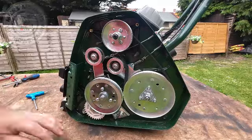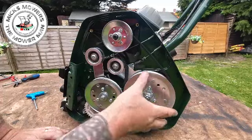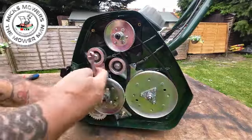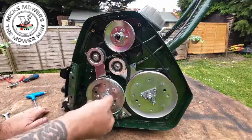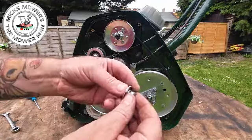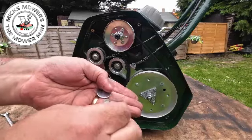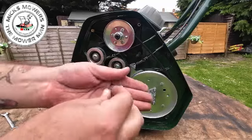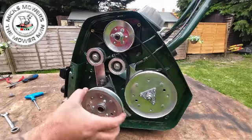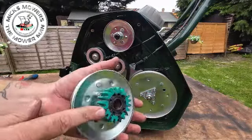We're now down to the meat and veg inside the inspection panel. This one here is your cylinder pulley, this one here is your drive pulley. On your cylinder pulley there'll be a 10mm bolt - all we have to do is just loosen that off by hand. There will be associated washers: a big penny washer, a smaller washer, and a split washer. Make sure they're in the right order when they go back on - put them in a tiny tub and keep them safe.